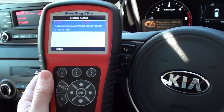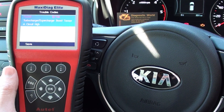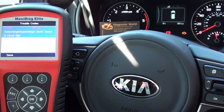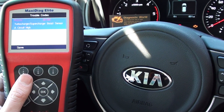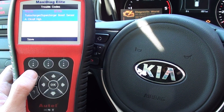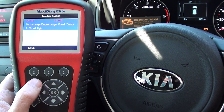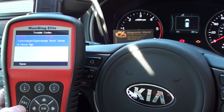And that's the reason why we've got the check engine light. You may use this diagnostic kit to also diagnose the check engine light, but you might get a completely different fault code. In this case we've got a problem with the boost sensor, which we have actually swapped over. All we really need to do is simply erase the trouble codes and change the status of the ECU, which is telling the ECU that we have fixed the problem, so it will turn off the check engine light.